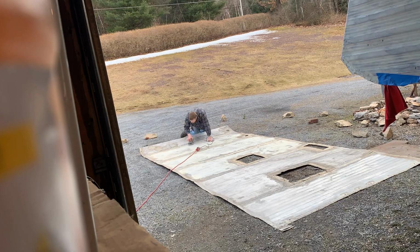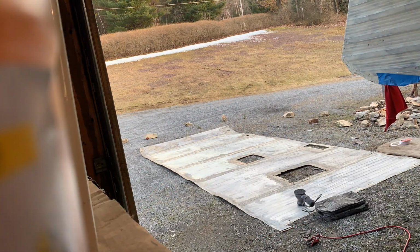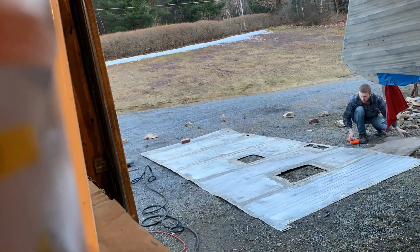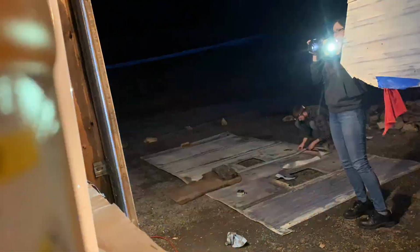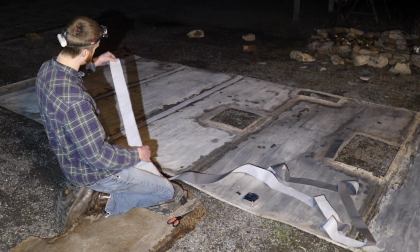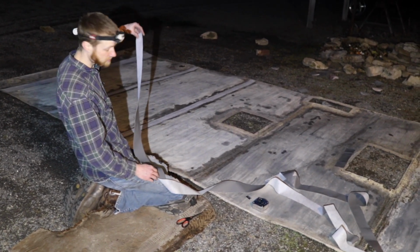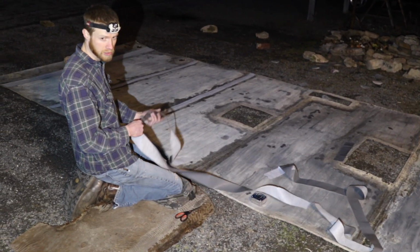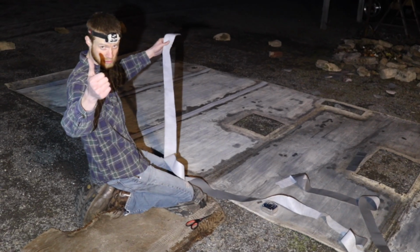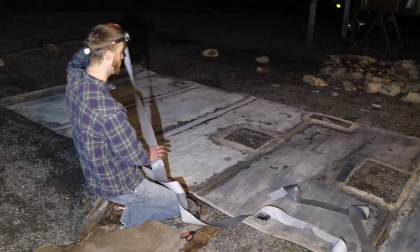Here I'm sanding with an orbital sander the entire surface with 320 grit sandpaper, and then the next scene you'll see us shining light onto the underneath to see where the pinholes are to seal them. We acquired some of this Eternabond web seal tape, which is for roof seams prior to a roof coating. Thanks, Mitch, for that.